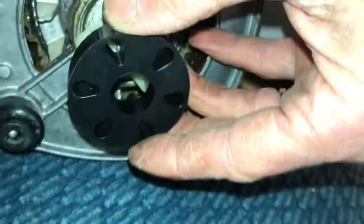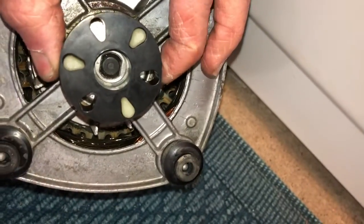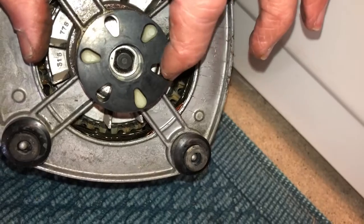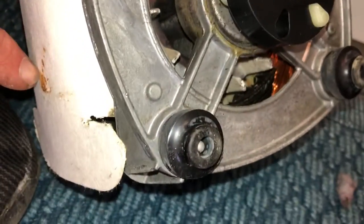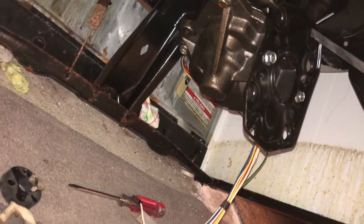I used this tool because it's big enough to fit over that shaft. Now we're going to do the same thing with the other piece — it's going to go on the transmission shaft. This rubber piece fits right over these little prongs. When you do this, if you see the three holes, try to put one at the 12 o'clock position facing the top of the motor, and the two others pointing out toward the corners.